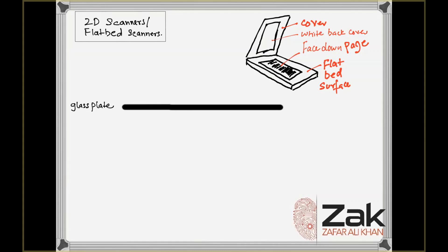The document is placed on the glass plate, and then a lamp — either fluorescent or xenon — illuminates the document. The entire mechanism, including mirrors, lenses, filters, and the CCD array, makes up the scan head.